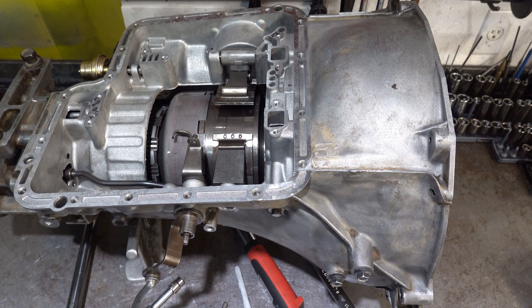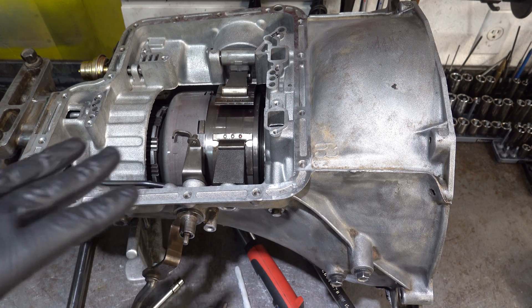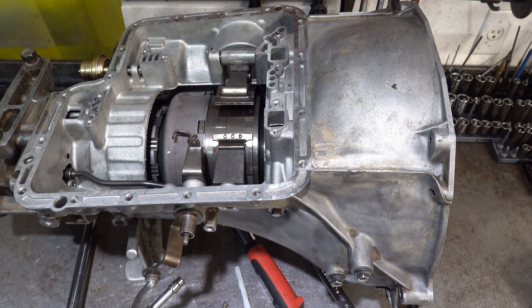The procedure is very straightforward and it's the same for any and all C6 variants. You tighten the adjustment screw down to 120 inch pounds or 10 foot pounds, back it off one and a half turns, and from there you assess - take a physical inspection of band clearance - then you turn the output shaft in the opposite direction of engine rotation while you observe the direct drum rotating underneath the band.